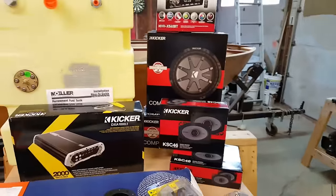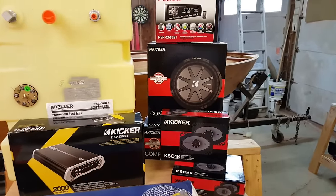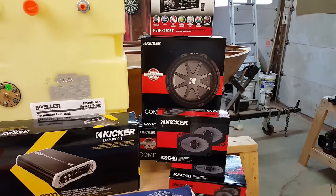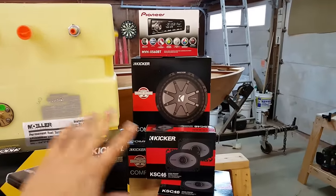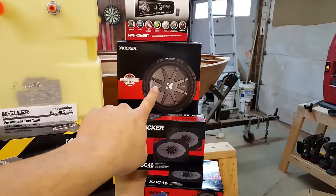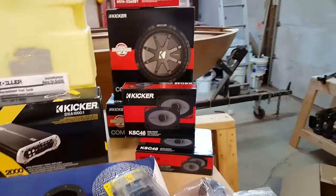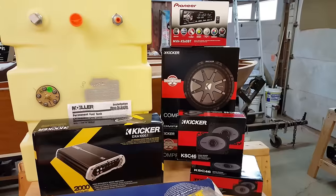The stereo — this may lose some of you, bear with me, it's all going to be hidden. There's almost a thousand dollars in stereo stuff sitting here. By the time I add wiring, patch cords, and things like that I'll probably be over a thousand. There's a Pioneer head unit — media player, no CD player — a pair of Kicker shallow-mount tens in their Red Line series, two pairs of Kicker 4x6s to mount underneath the carlings completely hidden, and a thousand-watt Class D mono-block Kicker amp to run the subs. I'm very confident this stereo will be loud enough that you'll never hear the outboard at any RPM.